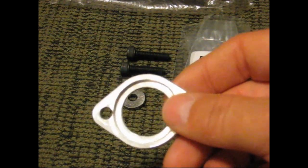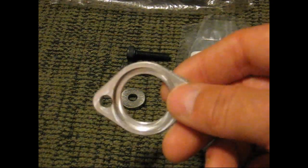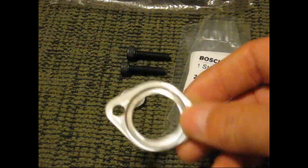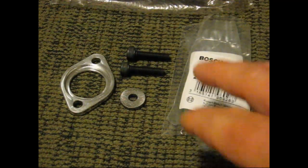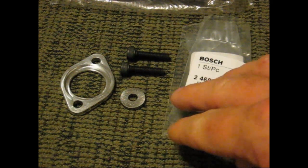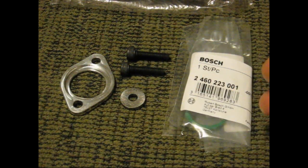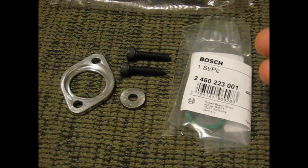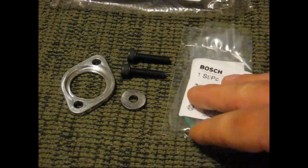By adding this shim kit that M&H carries here, it'll actually change the desired spring pressure and lets you get your timing advance out of this kit. Like I said, it'll actually let you keep your bottom end and gain top end. Think of it like a little 350 Chevrolet — they carry vacuum off the distributor. This is basically the same way on a diesel, but it's just done on fuel pressure.